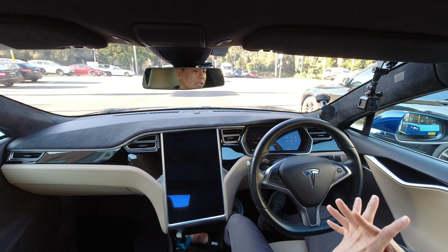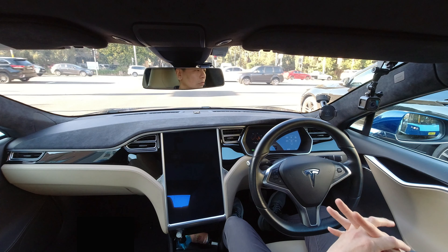I am currently driving my 2015 Model S. It has 80,000 kilometers on the odometer. It's got an MCU 1, the first generation. As you can see, it's currently not working but I'm still driving. This happened last night as I was getting very close to my home. I noticed the radio wasn't working so I reset the MCU with the two scrolly wheels. I noticed that with each reset it's taken a lot longer to restart the MCU, and last night it didn't come back. I gave it a few hours overnight, still didn't come back this morning. I'm concerned the eMMC, or the media memory card for generation 1 MCUs in older Tesla Model S's like mine, has failed. That is probably the biggest problem this car has faced in my almost four years of ownership.